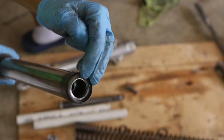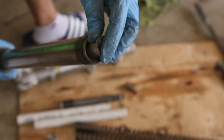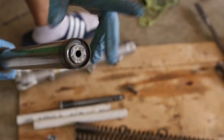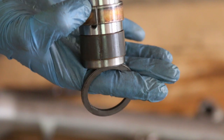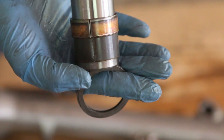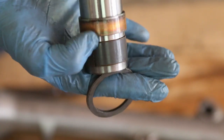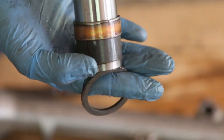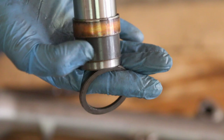Look at the bottom of the top part of the fork — there's a pretty large hole. If you slide this in, that's where it sits. We have a bushing here and another bushing — just look and inspect these to make sure they're in good shape. It's usually the color you're looking for, but if you're unsure just get a whole rebuild kit and replace them.